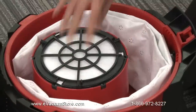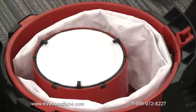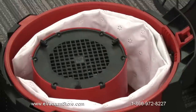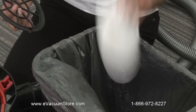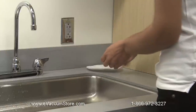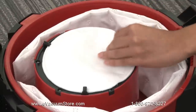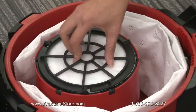You should check the motor filter each time you change the dust bag. To do so, turn the filter cover counter clockwise and gently lift the filter up and out of the unit. If the filter is dirty, tap it against a waste container to remove dirt, or if needed, clean it in warm water with a mild detergent. After the filter is clean, let it dry for 48 hours before you return it to the vacuum. To replace the filter, simply slide the new filter into position and pivot the filter cover clockwise until it locks into place.